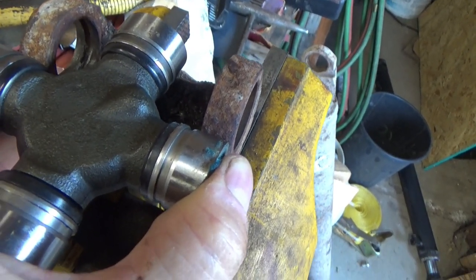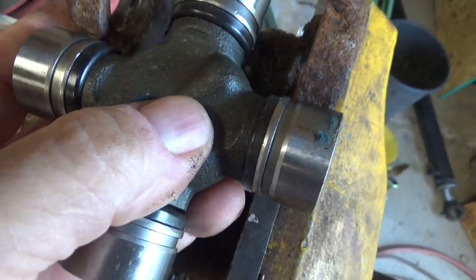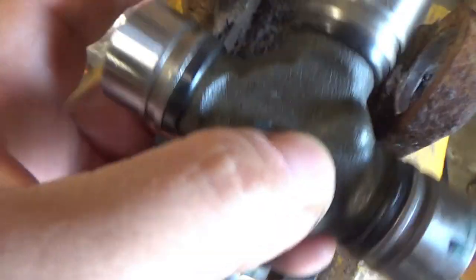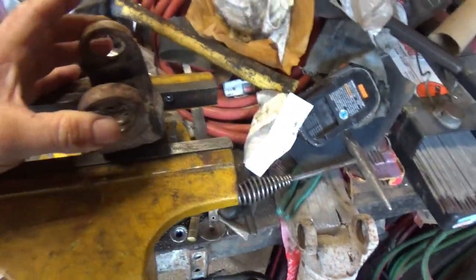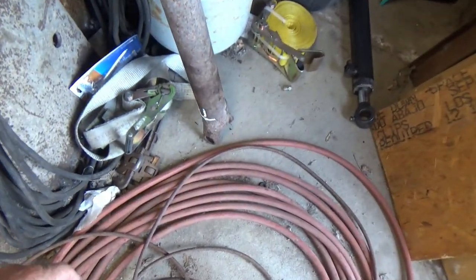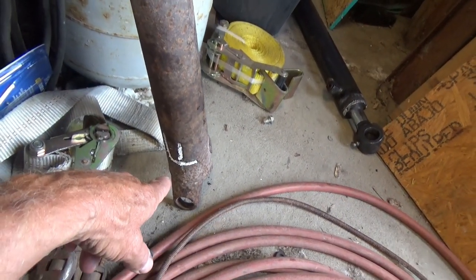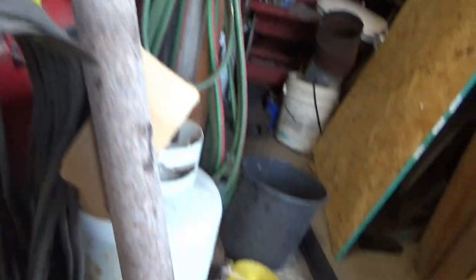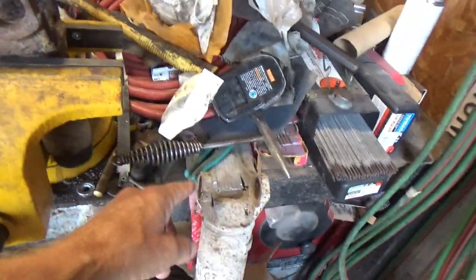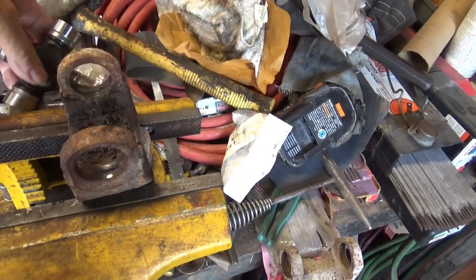When I put this up here, if I line this side up on the right and come over here on the left, the groove that the clip goes in is going to be all the way inside — not out here where I can get the clip on it. Another important thing to mention: the front of the driveshaft is going to have this slip yoke on it that goes next to the carrier bearing — I put a mark 'F' there — and 'R' for the rear, which goes on the differential end.